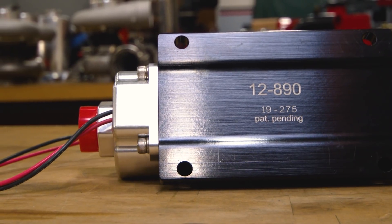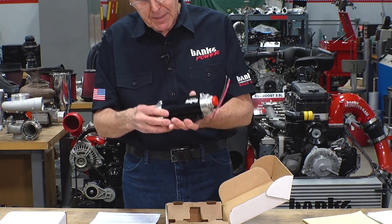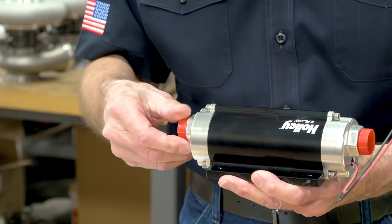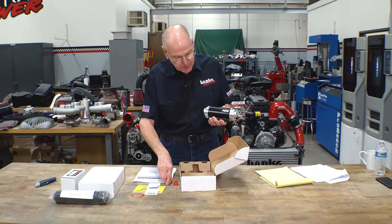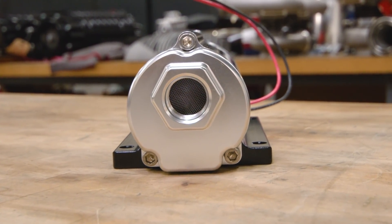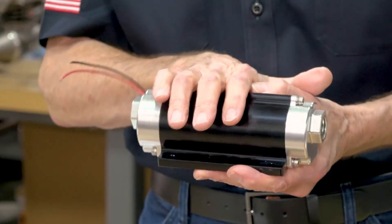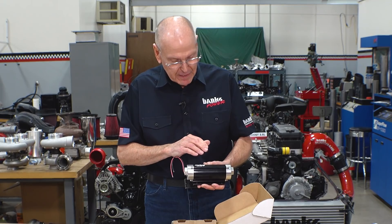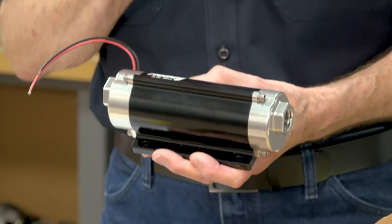The thing I like about these pumps is they're inline — you're not coming into the pump and going out of the pump. It looks really sweet in the dyno cell and would look really sweet in the vehicle. This single pump has an AN O-ring dash-eight fitting in and out. Even though you've got primary filtration before the pump, it's got an internal screen as well to catch anything you might have missed. These pumps are set up to run at a constant speed. They're gerotor pumps, and I love gerotor pumps — they're technical, they're OEM quality, and these things have a life expectancy in a vehicle of well over a hundred thousand miles or three thousand hours plus.